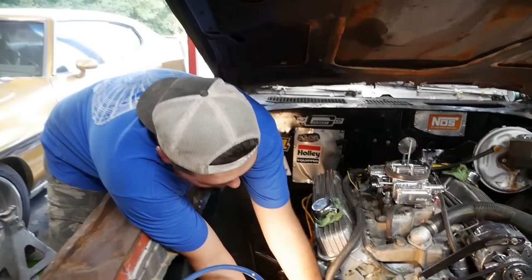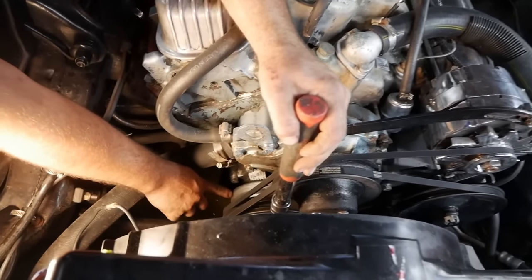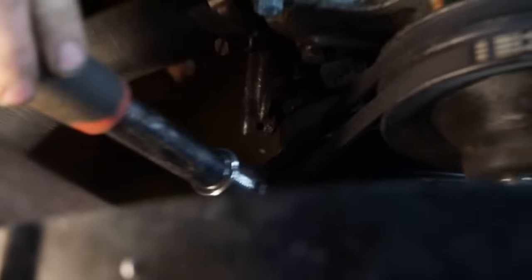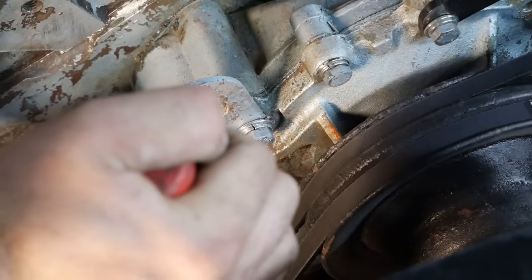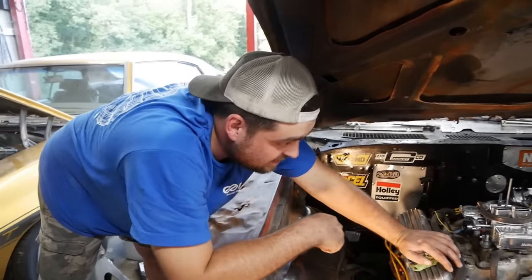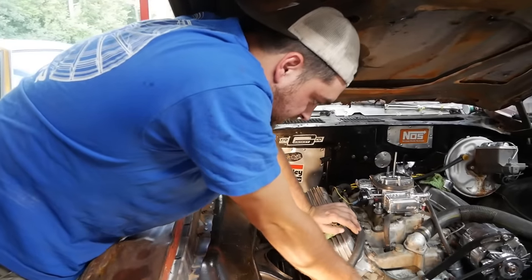Here's the mark on the balancer — this shows us where the crankshaft position is. If I rotate that to zero, it should be top dead center — and that's pointing right where number one was. That's pretty good. Let's put the piston stop in, back the engine off TDC, thread the stop into the hole, and roll it until the engine stops. The balancer mark is just a little bit off.